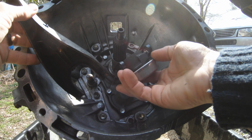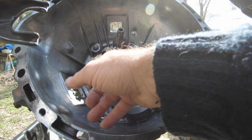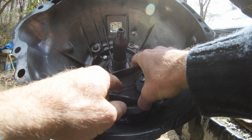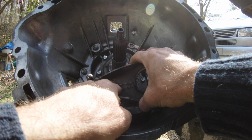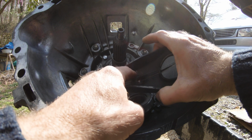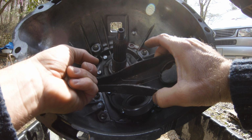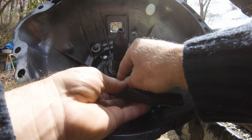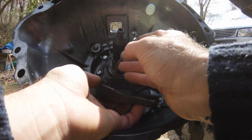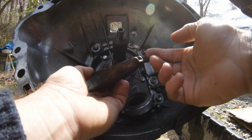bearing with its clips. The way this works is you have this pivot point here on that little bolt that sticks out. It's got a rounded top. That rests inside that little section right there. It's built in, so there's your pivot. This spring holds the fork to that head of the bolt. So what you have to do is get this off of here in such a way that you can get it on there and then put this in and lock it in place. It's very obvious the way that this thing seats, the way that it locks in there on that side.